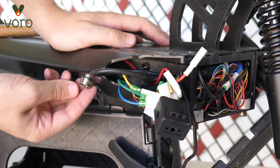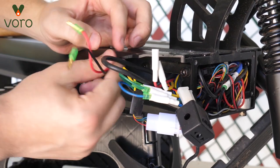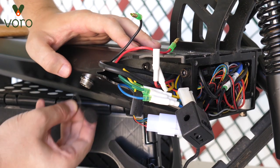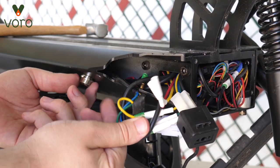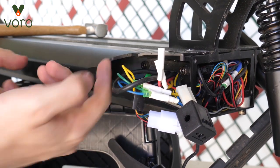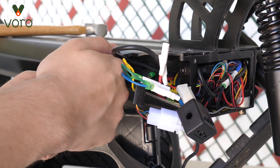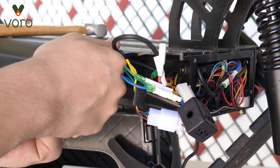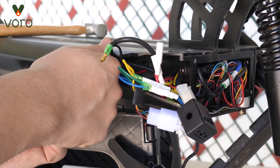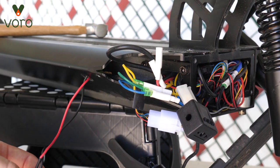Now we're ready to get the old power outlet out. You're going to want to pull these out loose so that when you twist this they can move freely. But you're just going to keep on twisting this out. Now if you reach your finger in, you're going to notice a small little washer against this on the inside. The goal here is to get that washer off of the outlet on the inside. So you're going to want to try to reach in, pinch that washer while you twist the power outlet on the inside, and then spin that washer when you're able to. I'm going to go ahead and pull it out and show you more in depth. All right, I got it loose and now I can just pull that out.